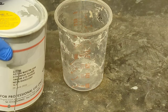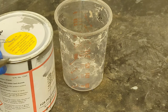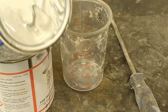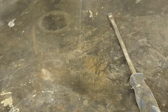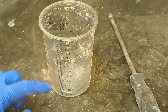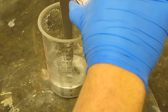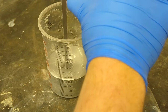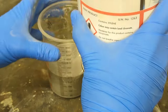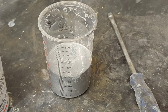Right, I'm going to mix the paint now. Now this is just base coat, standard stuff. Give it a good shake and then you mix this 50-50. So that's 50% base coat, 50% thinners. Look at that colour — beautiful. I want plenty. The cup is clean, I do assure you that — it's just static that's stuck dust to the outside but the inside's been completely clean. Alright, that's 250ml, we'll start with that, and obviously we need 250ml thinners.